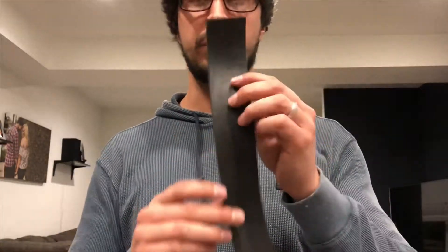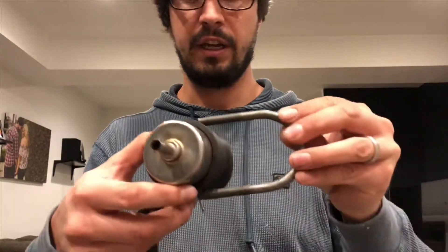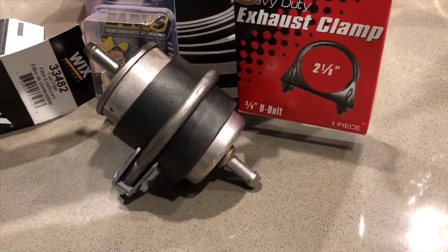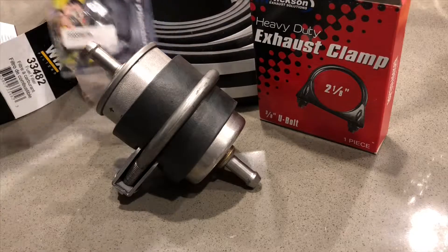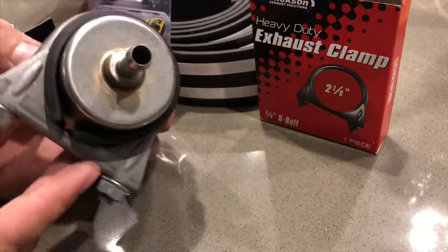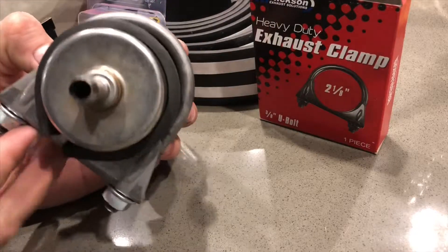If you remember when I did the fuel tank, I decided to use some rubber cushion with an adhesive back. I think what I'm going to do is just wrap this around, cut it the right size — the clamp will go over. This is a 2 1/8 inch exhaust clamp, and this is the Wix fuel filter that comes with the kit, number 33482. You're also going to need some Earl's fittings or similar hose clamps. These two will go through the frame and this will be captured on the other side to hold it, offering a little bit of vibration dampening.